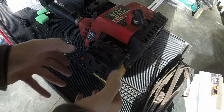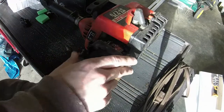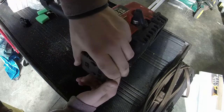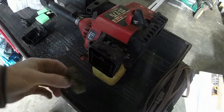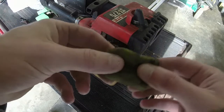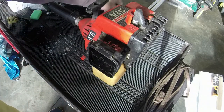All right, let's get into it. Air filter just pops off with 2 tabs. You just have to lift up on the top and lift up on the bottom. The bottom is a little trickier because of getting it. There we go. It's not quite as good access. So air filter covers off. This air filter, you can see that this probably hasn't been sitting in a bad area for a long time, because this air filter is actually pretty porous and it's not necessarily falling apart. Again, it's literally just a sponge, so we're going to replace the air filter as well.